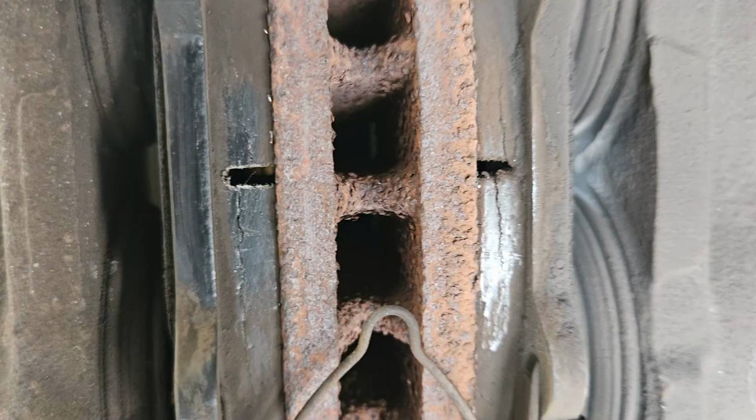It's been a while, but I got a few more Tacoma videos coming up because while the vehicle was on the lift, I noticed that the brake pads were cracking, maybe from all the weight of towing a trailer and everything on top of the truck. So we're gonna be doing front and rear brakes coming up soon. I just ordered those parts and also extending the lug studs to make room for these massive wheels. We're only catching a few of the threads at the end. So stay tuned, more videos on the Tacoma to come.